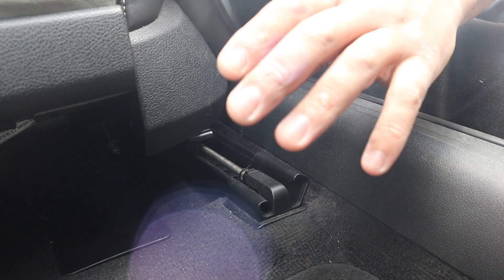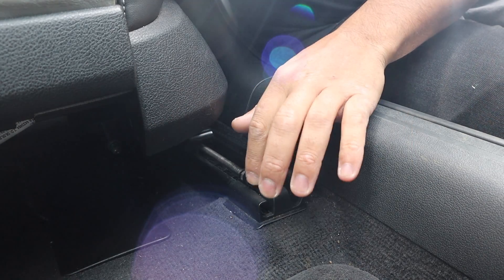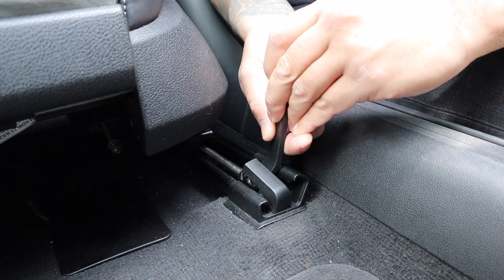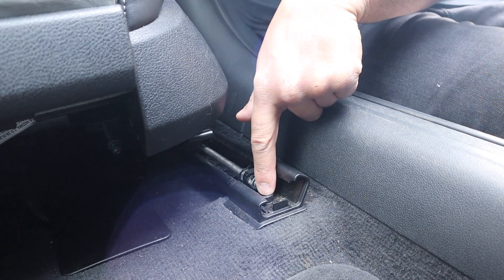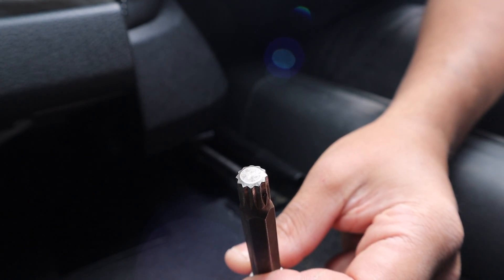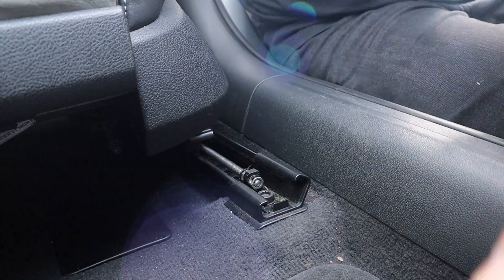So this is the front of the seat. There are four bolts holding the seat in — two at the front, one on either side, and two at the back. They've all got these cute little clips on them. This little part comes off first, like so, and then out. That leaves you with a unique bolt in these cars — and that's what it looks like. Pop the other side off and then we can loosen both of these bolts.